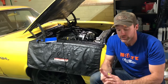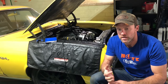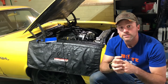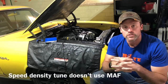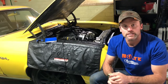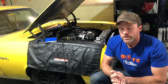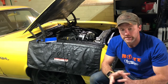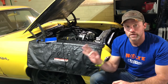Quick overview of my sensors - I am going from the 85mm circular-style Mass Airflow Sensor on my LQ4, which has both the Mass Airflow reading and inlet air temperature reading, to an LS3 card MAF. The reason for that is I want to use 4-inch tubing on my inlet side, and that is just a nice easy drop-in. It's a very popular mod, especially when doing this LSA swap. That also has an IAT, but I'm not using that - I'm going to the IAT on the lid itself.